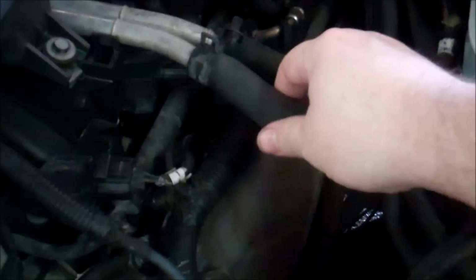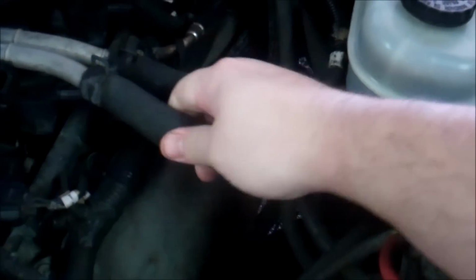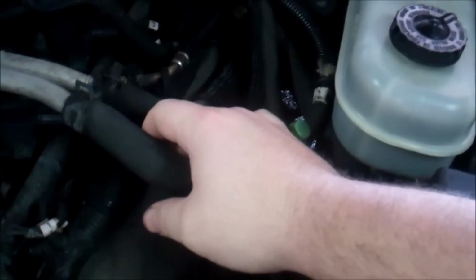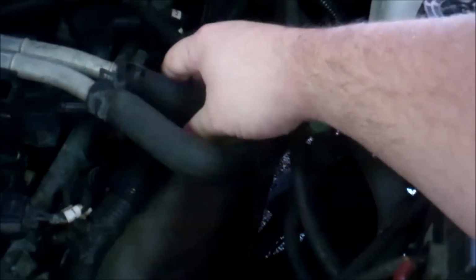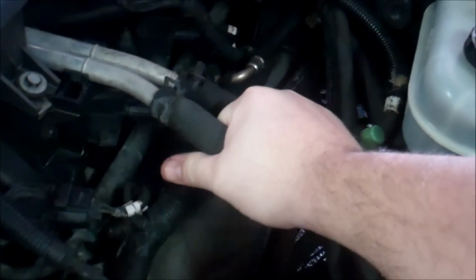Right here, heater hoses. Bam. And this is funny because this is definitely the return line, because even sitting next to the valve cover, it's chilly. I bet if I pop that hose off, nothing's going to come out. So yeah, it is definitely blocked up. And this one is definitely warm, a lot warmer than this one, but I can't really distinguish with my hand, because the valve cover is literally within an inch of the top of my finger, so I'm feeling the valve cover heat. But I would definitely say it's blocked up.